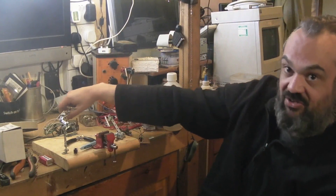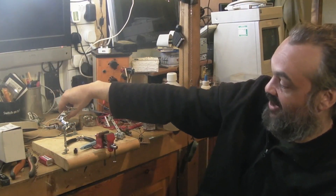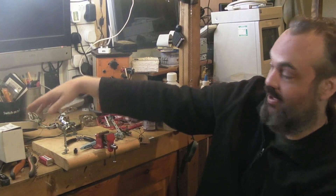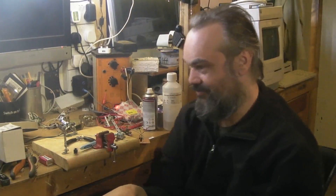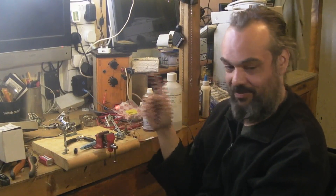We can actually derive the power for the amplifier from this little auto transformer that is built into the motor, which is kind of nice. What we will have to do though is change the spindle on the motor because this came out of a full size BSR deck. The size of the spindle has a relationship to the size of the platter — basically if you put the wrong size spindle on an incorrect platter the speed of the record won't be right.